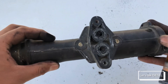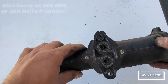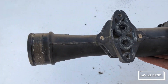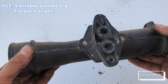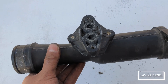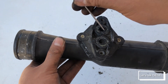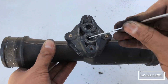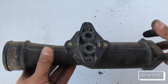Here on the top we have the EGR Delta pressure sensor, which is responsible for controlling the turbo and the EGR valve — how much it opens, how much it closes, how much the VGT needs to move. To clean this one it's really simple: you need hot water and something pointed like this, like a hanger, and you just try to clean it around, all the way around both sides.